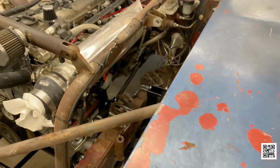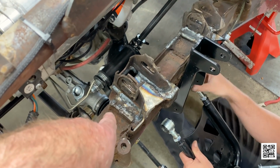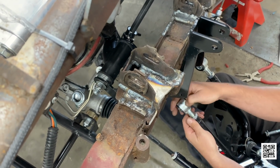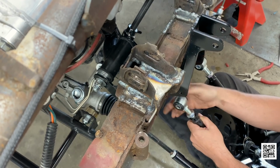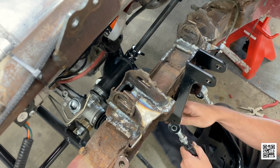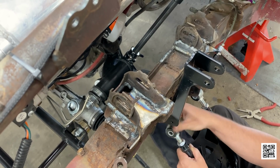Now the exciting part. Okay, so to recap, both mounts cut, lowered, moved inboard, and that was all in the name of giving us negative camber as the wheel moves up and down, and some caster gain. We also, I think, made it a little stronger than it was with some gussets and some strategically placed MIG welds. I feel good about this. Probably should paint over all this, but that's not going to happen because we're in a hurry. No, it's death metal. It's got to be rusty. It's going to turn into patina here in Georgia in about a week and a half anyway, so it'll blend.